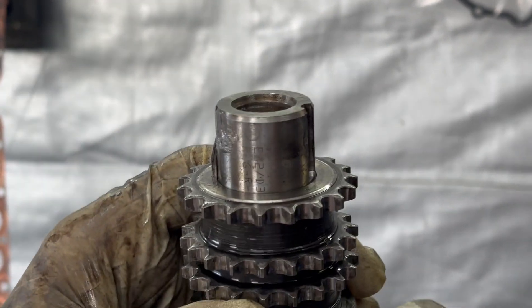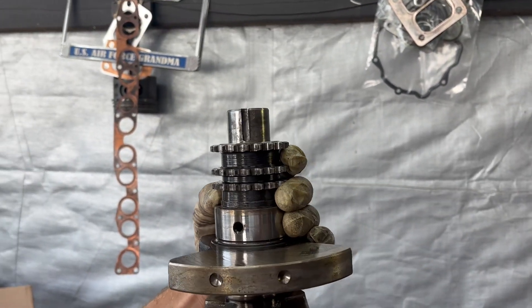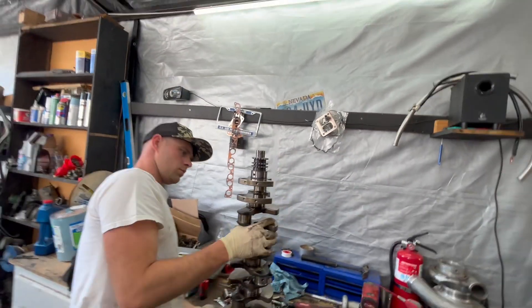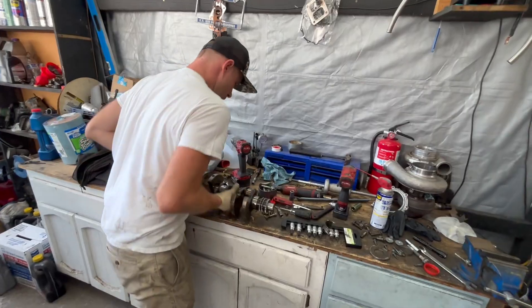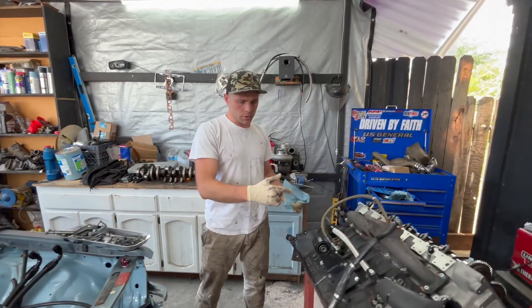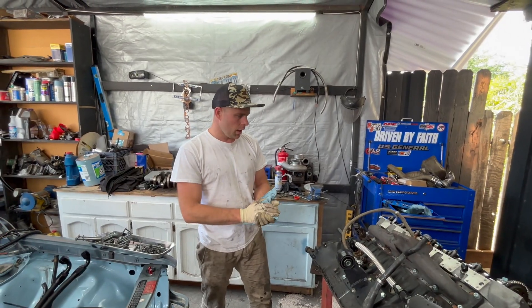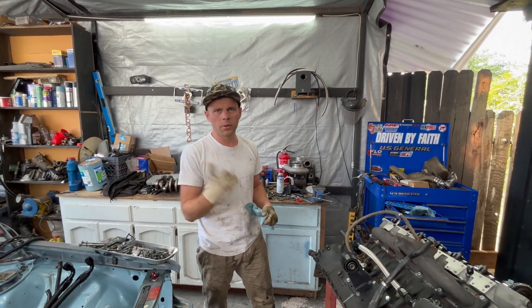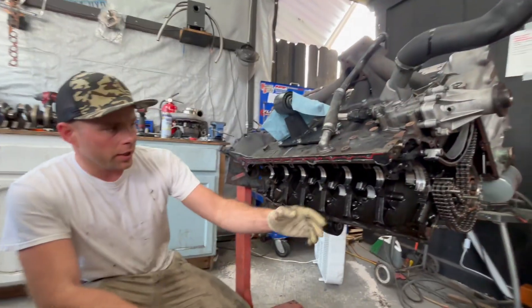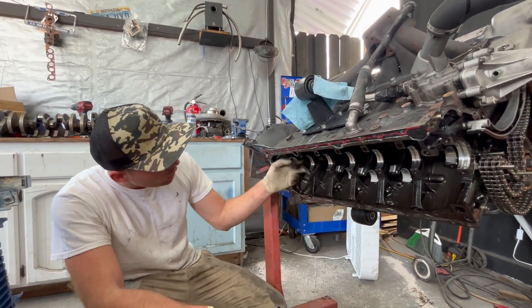You can see the stock keyway started really eating itself in there on both sides. And on the pin where I drilled and pinned it, you can see it's starting to eat itself there too, which is interesting why it's only doing it in that spot. So we were thinking of sending it to the machine shop, but hopefully we can find another crank instead. We wrote to the rod builder, Diesel Pump UK, to see what his take is on what happened and what we should do next — so we're waiting for him, he's probably sleeping right now.